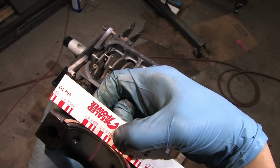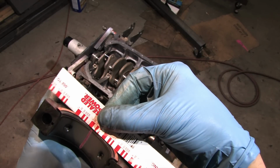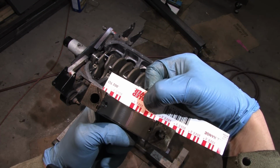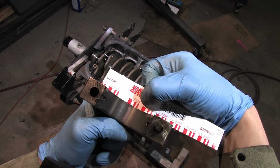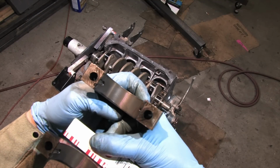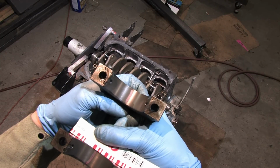While it's better to hit spec on your average street-driven daily driver, this engine doesn't exactly conform to having a normal factory oil system, and I view this wide spec on the mains as a good thing. Since this is a no oil squirter, no balance shaft, non-turbo block, it's missing 7 oil galleries, and there's a lot of oil volume being pumped that would appreciate having somewhere else to leak out of.